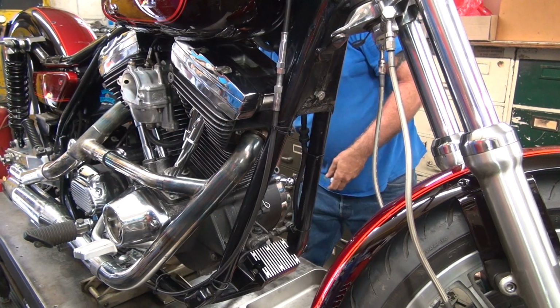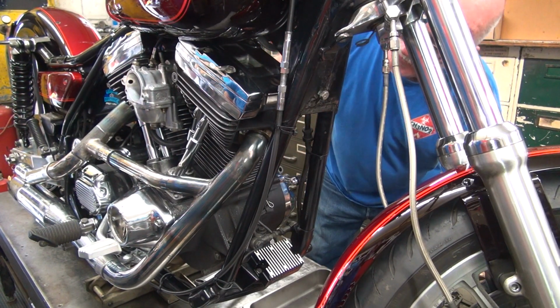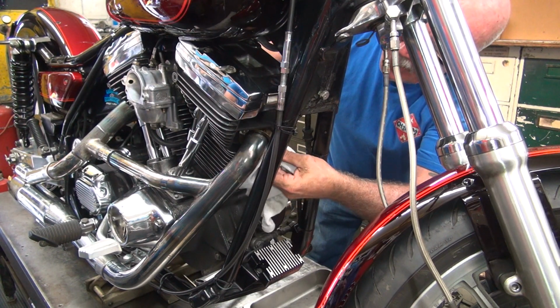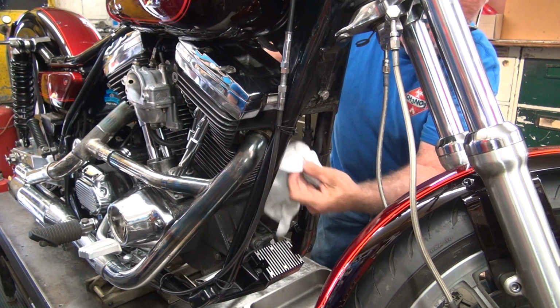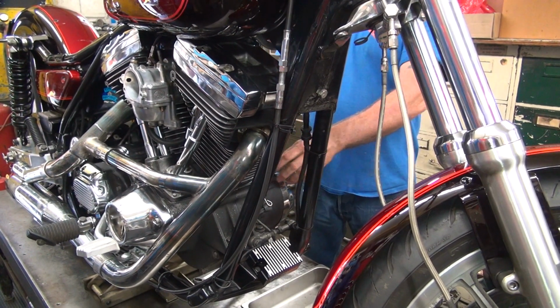And what would that problem be? Valve seals? I mean, you got a hell of a lot of oil in your combustion chamber. Now, you had that spark plug out. Did you look at the spark plug before you put them in there? They look clean to me. Okay, there's no oil on them, was there? No. So that means that's good. You want to plug the wires back?